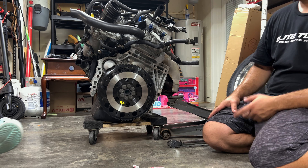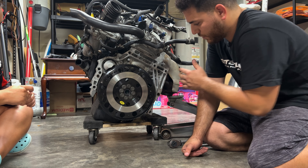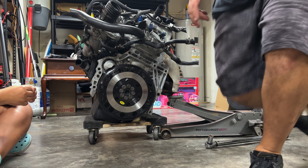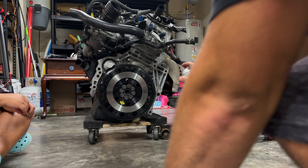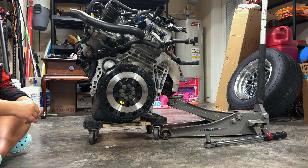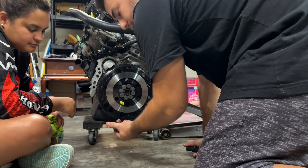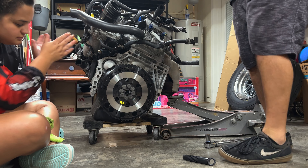Anything that has friction - be it brake pads, clutch kits - you can't have grease on it. It has factory oil and you need to wash that off with brake cleaner or alcohol just to take that film off. They put the oil there so it doesn't rust, but it obviously needs to be taken off. Easy way - a little bit of brake cleaner and just let it drip off or hit it with a rag afterwards. This right here is called a pilot bearing. Some engines have it, some don't. This basically just needs to be pounded in here - pretty simple.